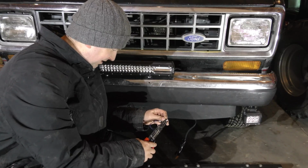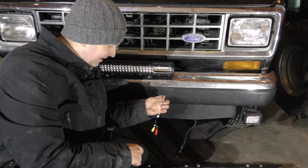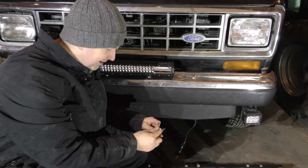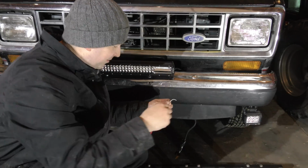And I think we'll just cut the end of this off, call it good. The white wire, by the way, I did test this. The white wire turns off the line markers. So if you don't want the line markers on, you connect this one. So you connect all three of them. The blue and the black reverse the image, so basically mirror the image, flip it around.